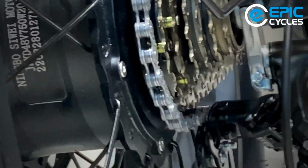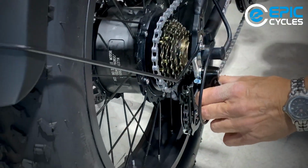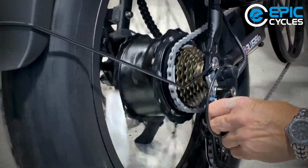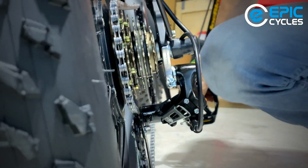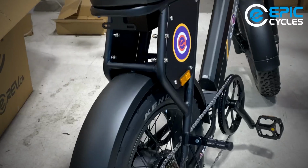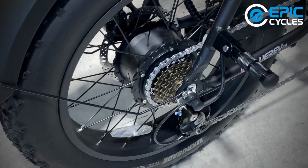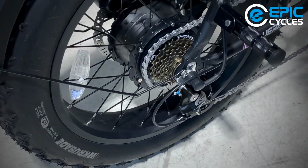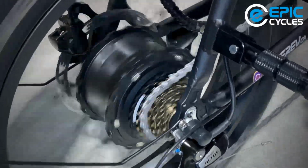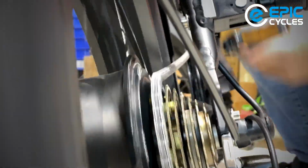Check the knee. No, still wants to move a bit. Give it a tiny bit more. Check the knee. Now I want to make sure that I didn't lock it out of that gear. I can't make it overshift. That's good. So it's fine. Right now we're all good. One more check on the gears, just for everyone to see. I'm going to put it back into first. Here we go. So first, second, third, fourth, fifth, sixth, seventh, and then back.